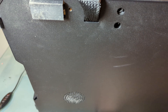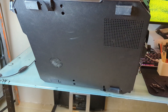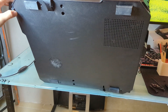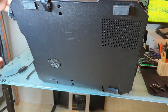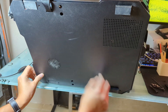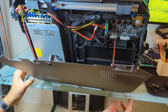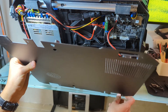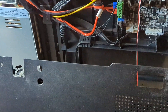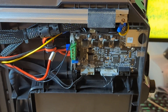If you can get your printer a little bit to the edge of your table, it's going to be a lot more helpful. Now with those four screws removed, if you have anything else — like in my case I have this little tab from the printer itself — go ahead and remove it. You want to be careful for these cables here; slip it through to the side there so that it releases. You would also want to remove the fan connector right here. In some cases it might have glue on it, and you'll have to remove the glue in order to remove it.